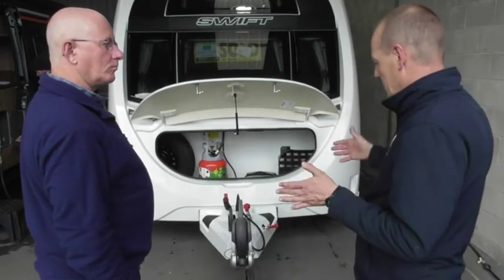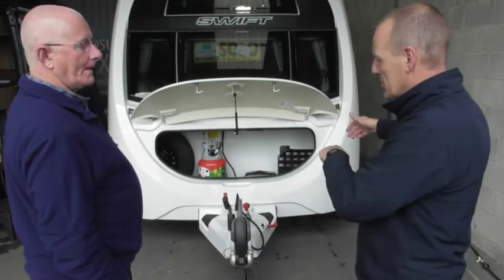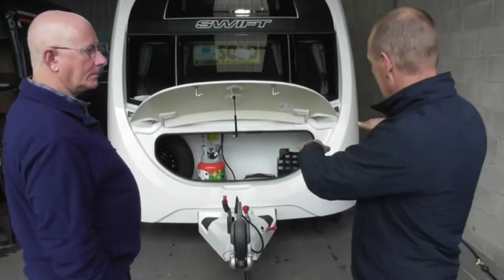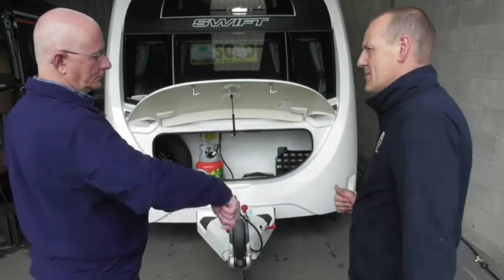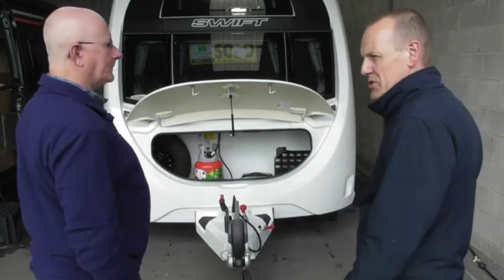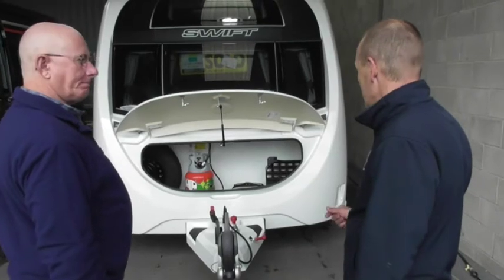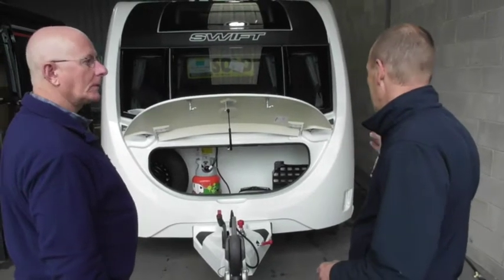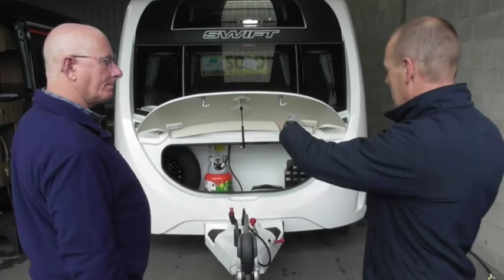So you may want to purchase ramps, so you just pull the van up using the motor mover or the car, lifting it up on whichever side. Oh, you've got one of those winder jacking things? Yes. That's so much easier. That's what George recommended. Yeah, they're good. With that, you can line up the wheel lock if you have an Alko wheel lock, and then you can lift it. It's a lot easier. Level it side to side if you need to.